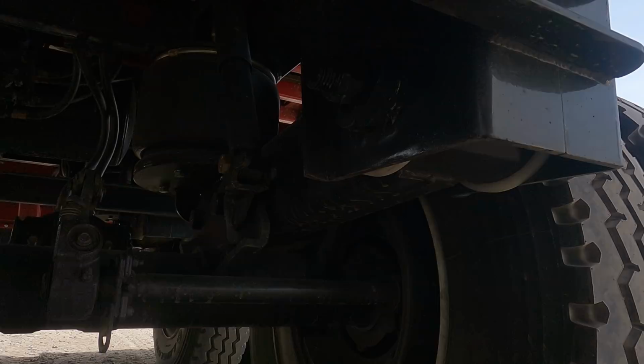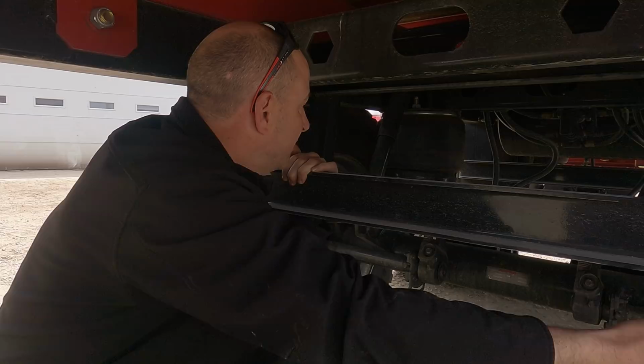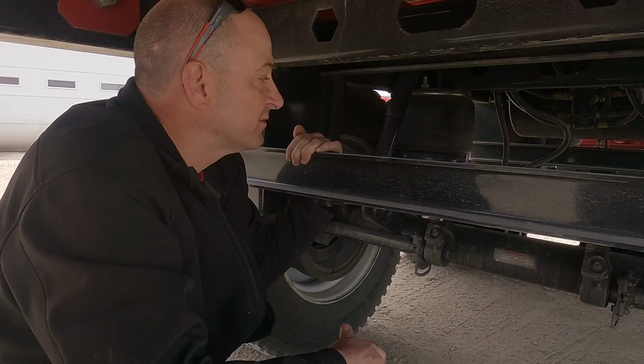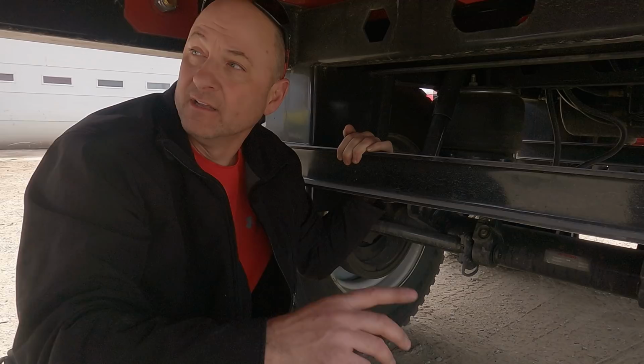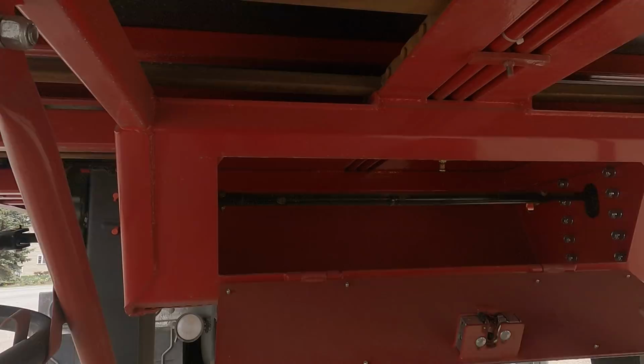But you know, here's your inside locking mechanisms, your super oversized bolts on that system, and we've got a, so this is a 60,000 pound air ride suspension, two 30,000 pound axles, Hendrickson's airbag 30,000, then the Hendrickson's bushing in here, and which the suspension is, I truly think, another super highlight of this trailer, of just giving it the strength that the competition doesn't come close to when it comes to that. All tubing back up through here underneath everything. Tracks are running back up through on top of the angle right there back to the front. And then they even do offer, or come standard with a little toolbox carrier here if you're looking to store a little bit of stuff in there, which has always come on all the trailers.